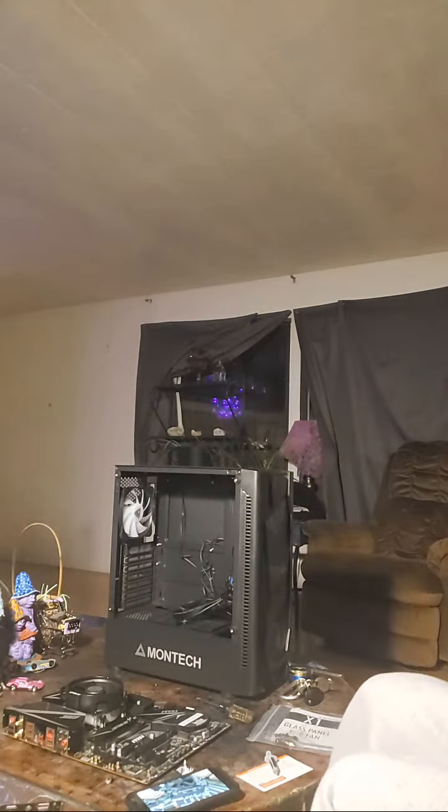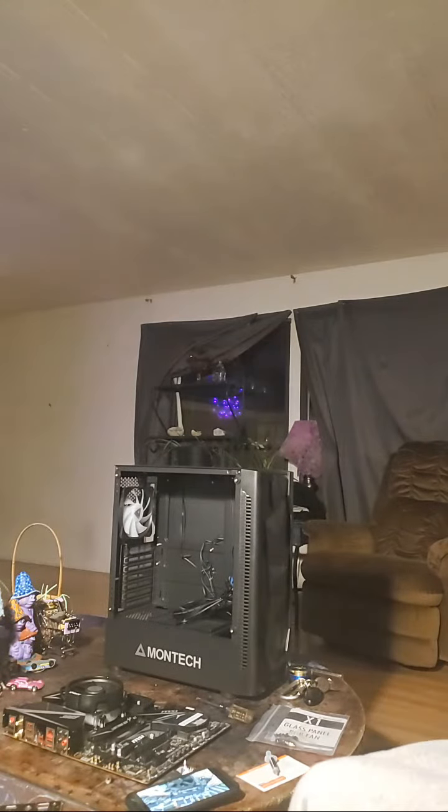So we're not running into any clearance issues, but you might have one that's too large and kind of encroaching on these leftmost DIMM slots. It's very common. And that could be an issue. Hopefully, if yours is only encroached because there's a fan on the side, you should be able to pop the fan off and it'll give you more open access to those DIMM slots, and you can go ahead and install your memory modules.